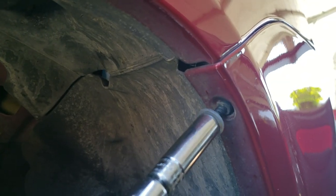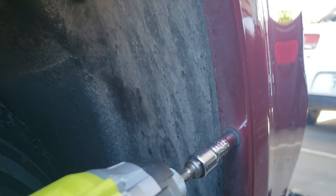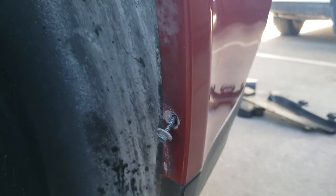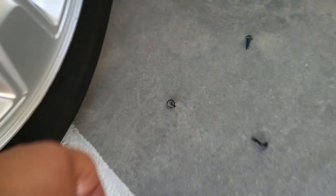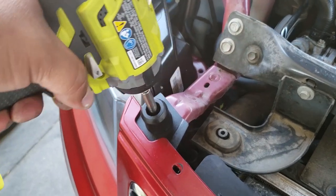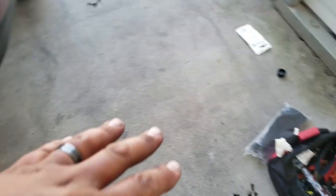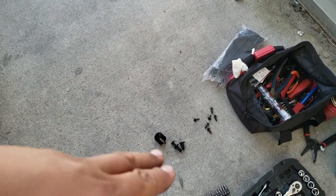To remove these — remember, the top one was a 10 and this one is going to be a 7. Just have your screws loose in a nice safe location so you don't lose them. One thing I forgot to do since I have this one on is remove this one — this one is a Torx 30. We'll leave this one on this side so that I know which screw goes where.